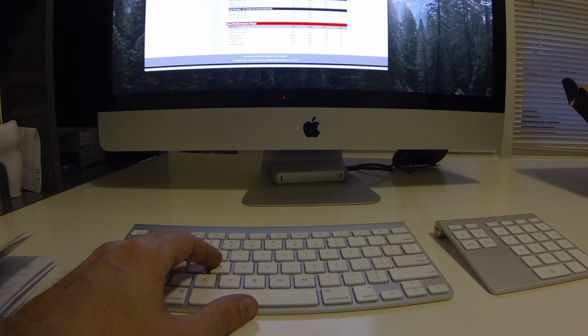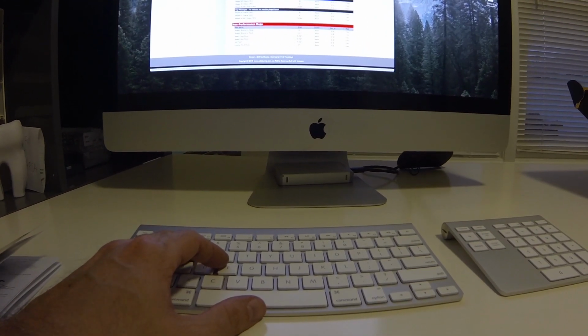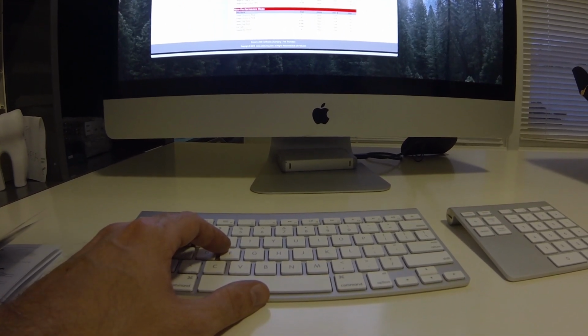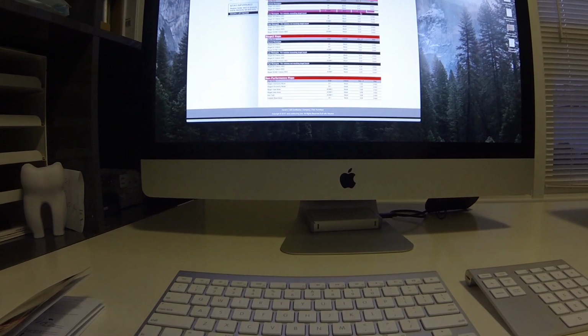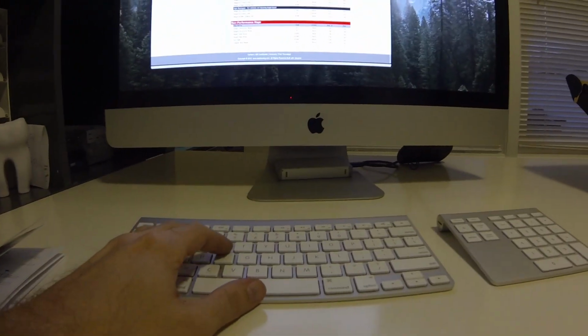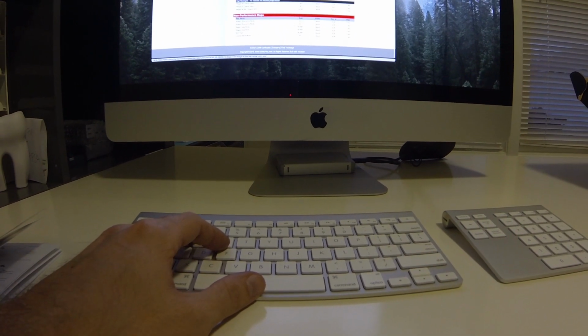We're going to do the Stage 1 ACN 91 octane. I'm in California here with crap gas, so 91 is the best we can get. I'm just going to try the normal wastegate at first. And I'm going to data log it and see what the boost is looking like and what the air-fuel ratios are looking like, just to make sure we're not over boosting. So I'll check that out. I'm going to download that map right now.